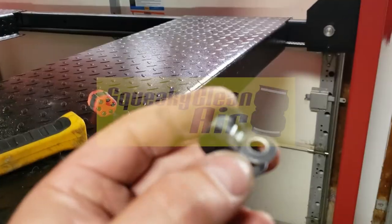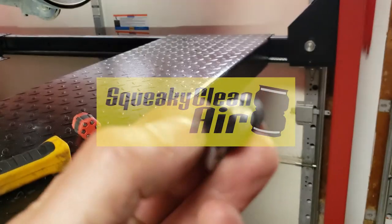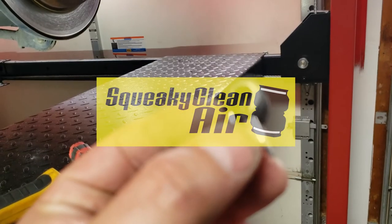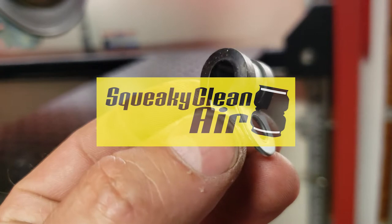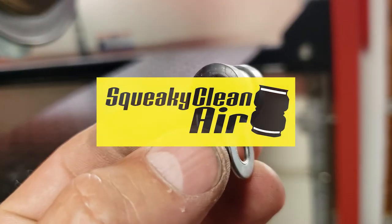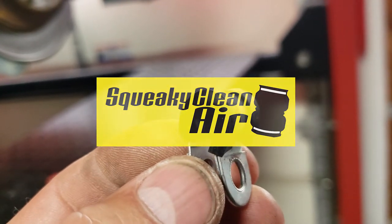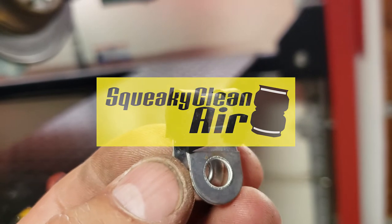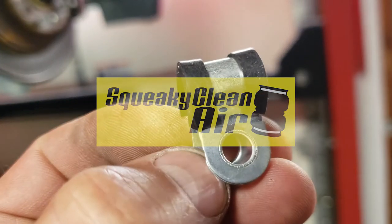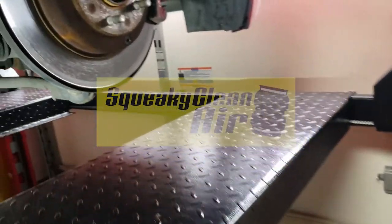This is one of the retainers I like to use. This particular one is for a quarter-inch line, and as you can see it has a nice rubber shielding which makes it very easy to put the line through — the line is not going to rupture and it will hold very securely. Don't tighten it too hard. I mount my lines using these, then put the self-tapper right through the hole. This is basically what they look like once they're mounted.